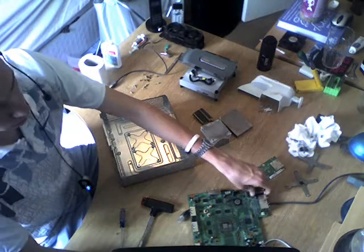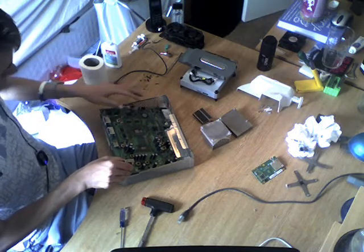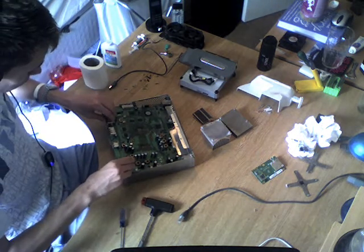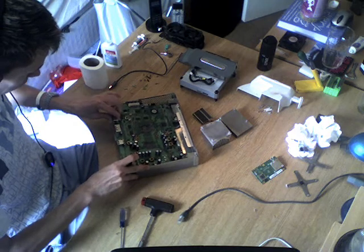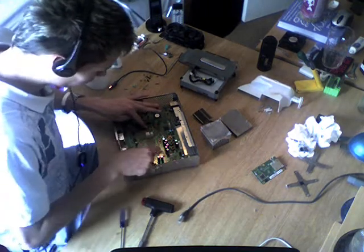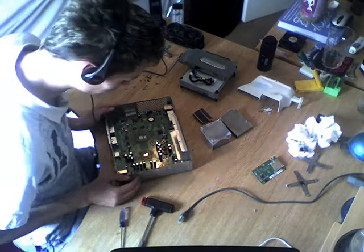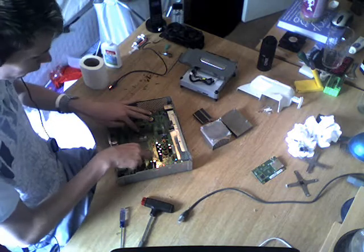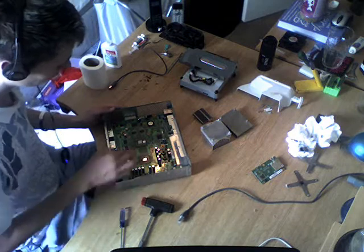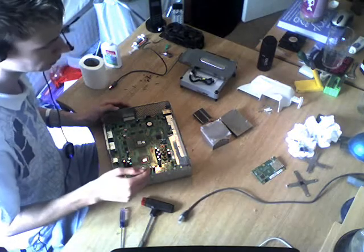Now what you want to do is get your motherboard and put it back on slowly, making sure you're not going to move those four bolts. And then you should be able to look straight through the holes and see that they're straight and centred. It won't flex the motherboard, and it will give the exact gap underneath for air and heat to flow through.